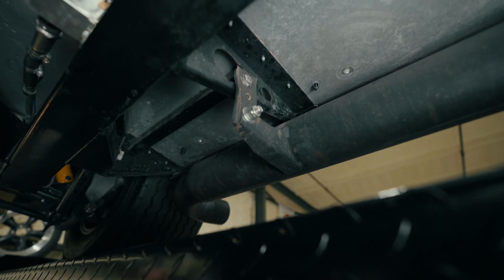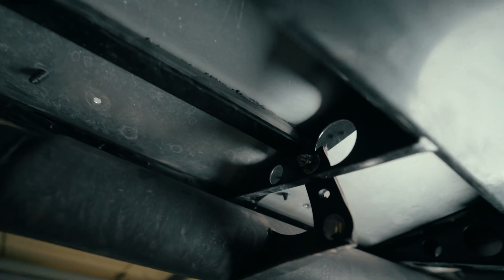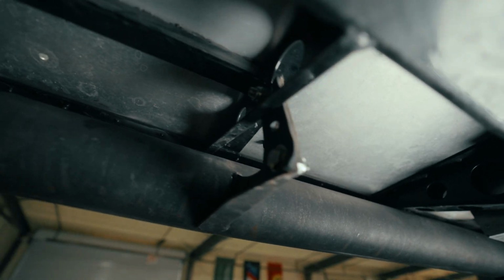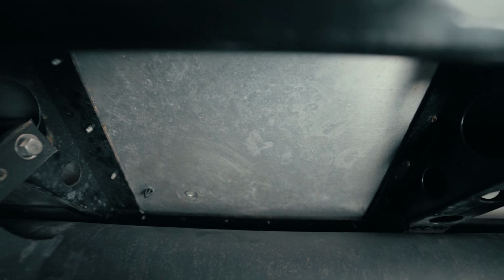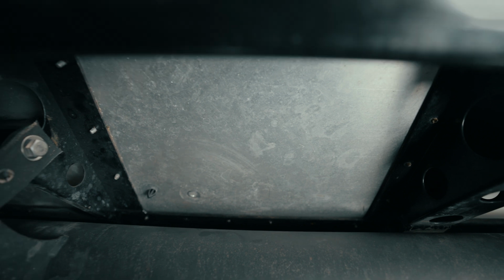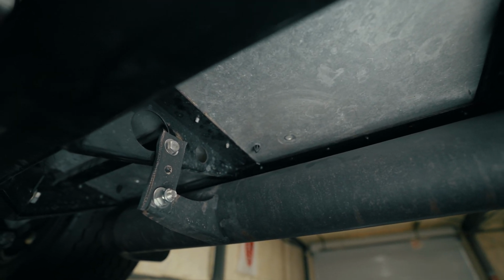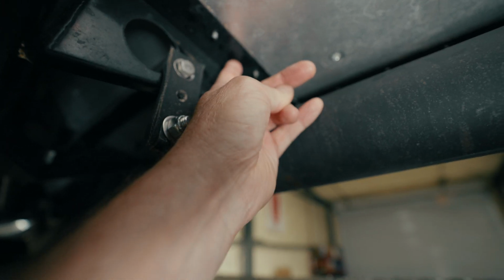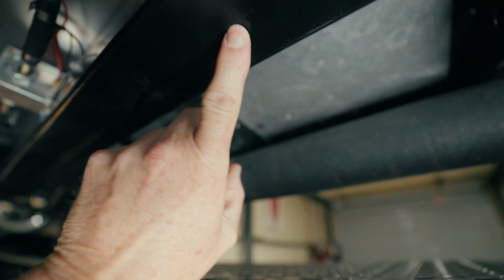So this ERA Cobra has a similar floor structure to the originals, and then it has these little frame outriggers here that extend over to the outer frame rail. This runs underneath the seat frame. You can see there's 2 outriggers there and a sheet of aluminum with some holes drilled in it. And those holes are set up to bolt the seat directly to the floor. There's no adjustment. So we want to try to get a bolt hole either into this outrigger here, which would give us a steel hard point, or try to get another bolt hole into the top of the frame.